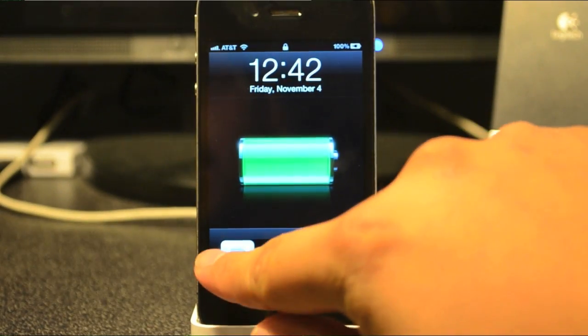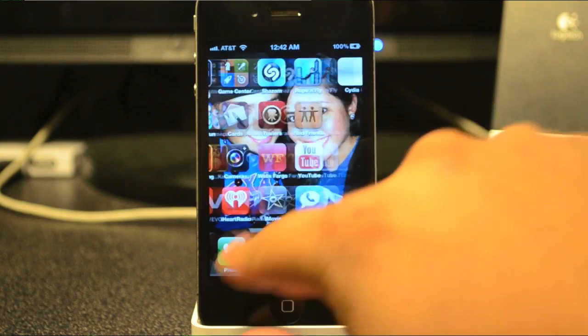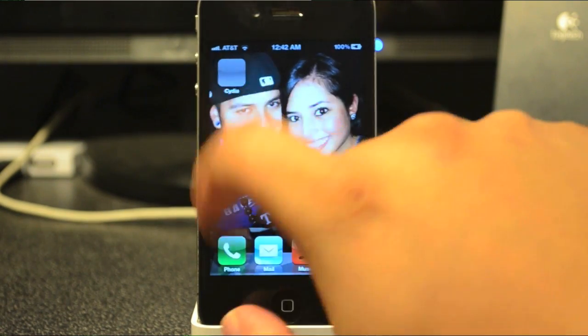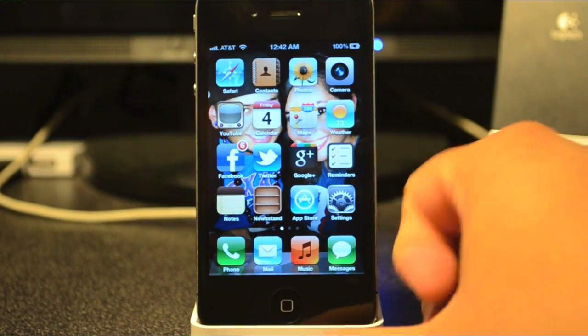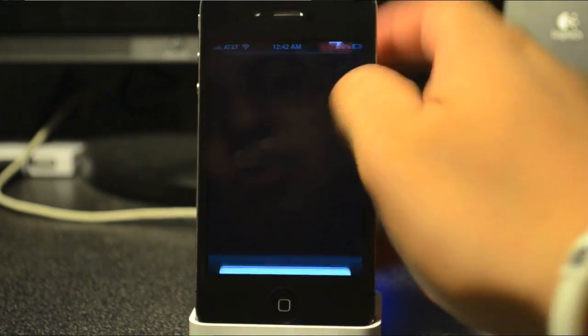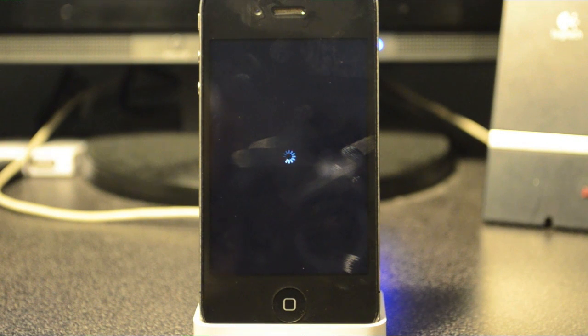All right, as you can see it is done. Go ahead and slide to unlock. Scroll over to the right and Cydia is not going to be able to open yet — we still have another step. We need to turn the phone off again and use the Just Boot method. This is what you'll always have to do whenever your battery dies or your phone reboots, because this is a tethered jailbreak. Every time your phone restarts you'll be stuck on the Apple logo and will need to connect to a computer and run redsn0w's Just Boot feature.